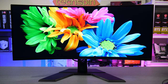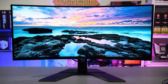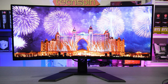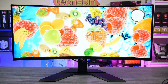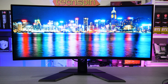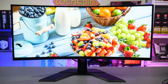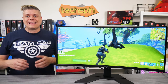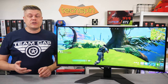Out of the box the screen looks really good — colorful and vivid with that slight bluish white balance shift. Gamma doesn't follow the curve well being too bright, though it's better after calibration, which makes colour accuracy excellent and delivers the right white balance. Check rtings.com for their profile calibration. With no local dimming, SDR peaks around 372 cd/m² with HDR at 487. Grey uniformity is very good, and we saw the same backlight bleed as the G32 QCA with five apparent top and bottom hotspots. It's only slightly noticeable on a full black screen, so in normal usage you'll maybe only see this a bit while watching a movie.